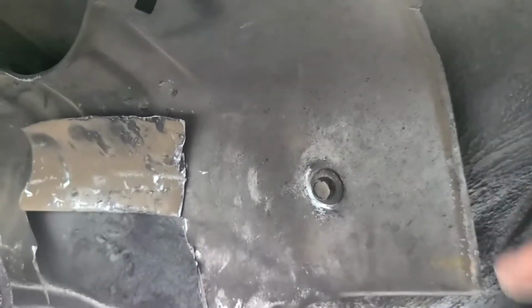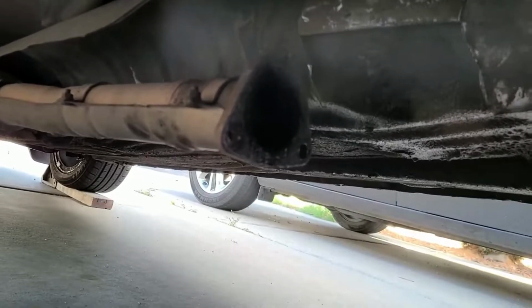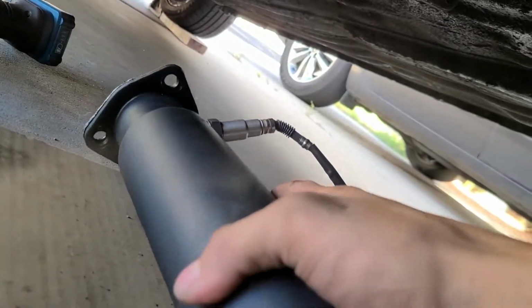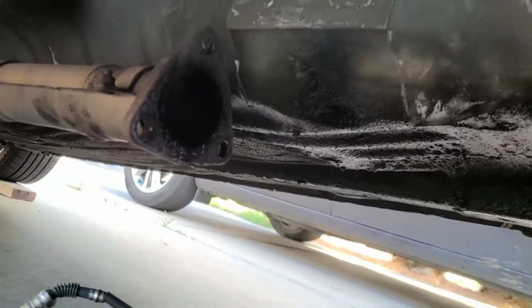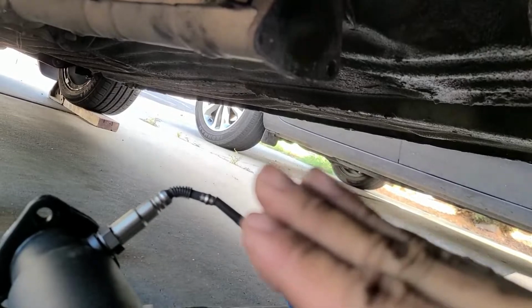The cool thing is I can run this O2 sensor wire up through here, even around that bolt, so once I get the O2 sensor, which unfortunately I don't think is coming in today, I can just plug it in through the engine bay. So I'm going to mount this thing up. If you guys plan on getting this, I'm going to leave a link down in the description below to this test pipe. If you get any other test pipe similar to this and you don't plan on welding your own O2 bung, just keep in mind they may not have welded the bungs in good areas. All right, got it.